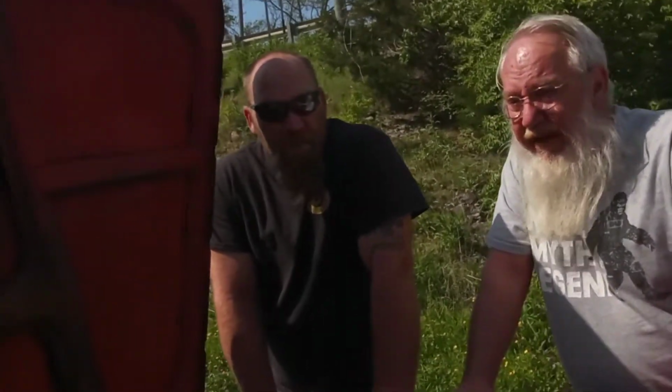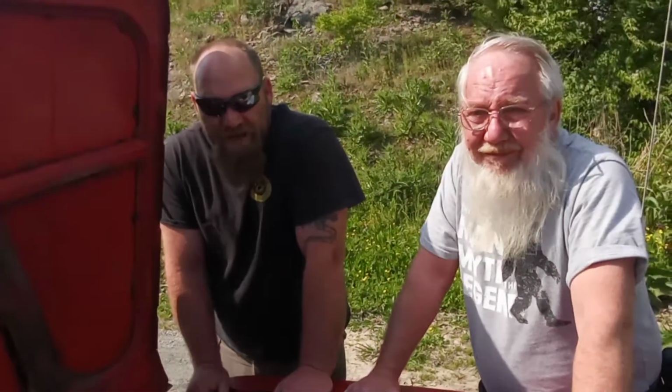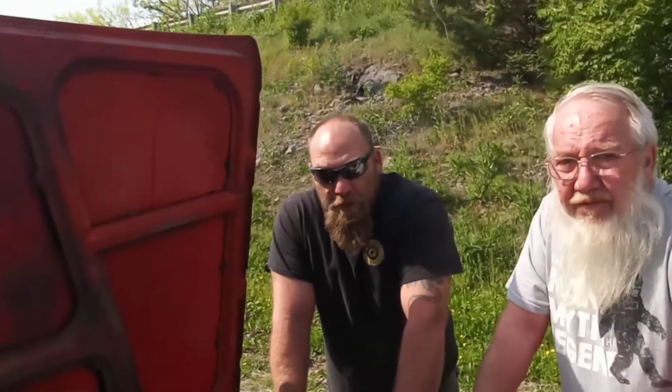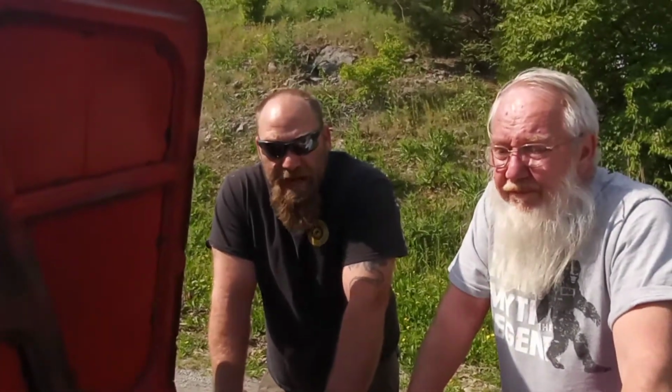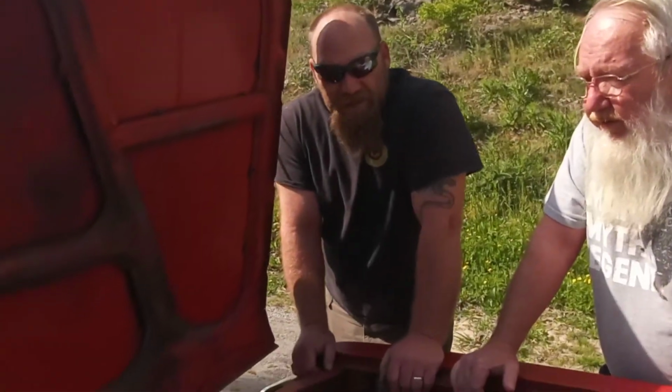And what kind of rear end and drive shaft did you have to do to this thing to make it hold up under this kind of power? For the rear end, I went with a 2001 Chevy Blazer full-width 8.5. That is the biggest rear end that Chevrolet makes, short of going with a 9-inch Ford. And you didn't have to modify anything to put it under here? No, it bolted straight up with the factory U-bolts. I had to have a custom drive shaft built for it for length and all of that. They had to cut it and make it the length you need? Yeah, I had a custom drive shaft built to hook from the rear end to the 700R4, for going forward and reverse.